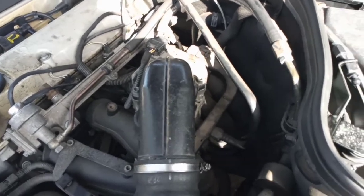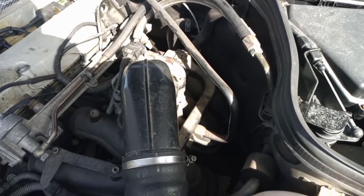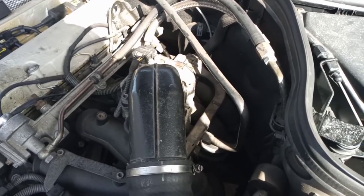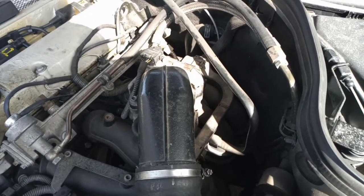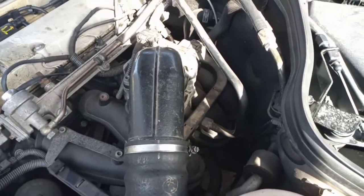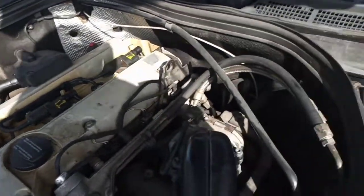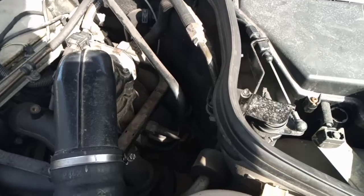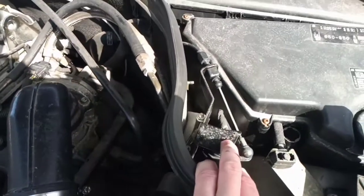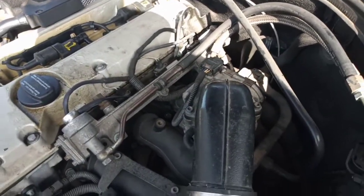It's a bit of a headache to tune, to be honest. It's a clever system, but a slightly annoying one at the same time, because you never get that feel that you can get from a BMW engine or something with this system. But anyway, most of you guys know how it works, but I just thought for those of you that might be interested, that is what happens with the throttle on these cars. So you don't have a sensor on your pedal. Your sensor for your pedal's here, and the TPS is built into the throttle body itself.